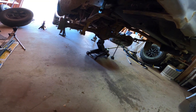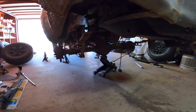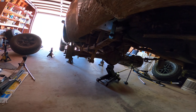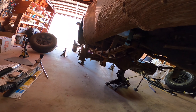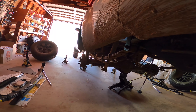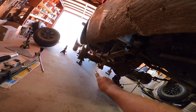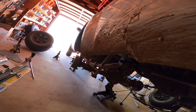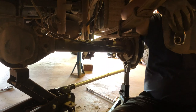With the wheels and spare tire off, we supported the differential with a hydraulic jack. This prevents the differential from dropping down or stretching the brake lines, which would be a really bad thing. The night before, I soaked all the important nuts and bolts with WD-40, which helped get everything loose — that and the California sunshine also helped.